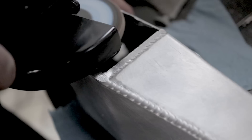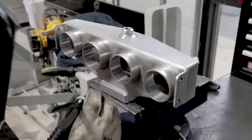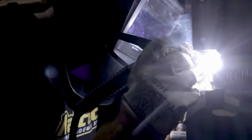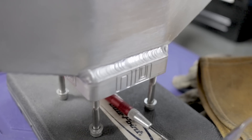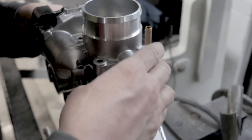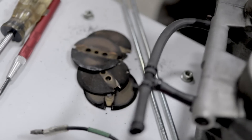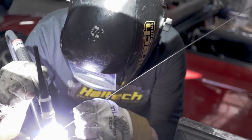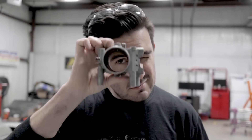By programming the gear ratios into the ECU, it allows the ECU to perform a seamless downshift on every gear. We're going to utilize the original intake plenum with the new throttle body. We also need to remove the throttle flaps inside the original tubes for each cylinder. With a little bit of welding, everything will be sealed up and act just like a standard intake manifold.